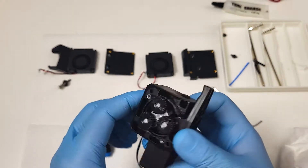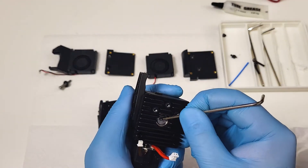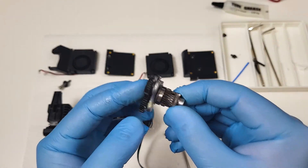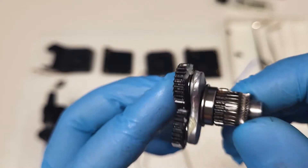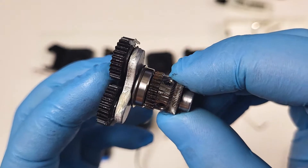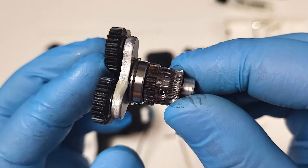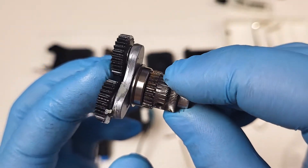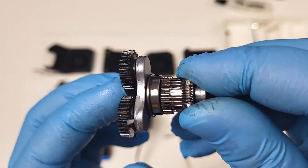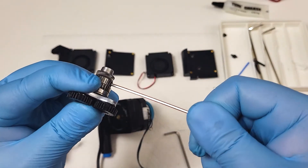There is a very rich amount of grease on the gears. Press the rod within the bearing and remove the planetary gear assembly. Remove the gear set and inspect the gears. Notice that unlike the SV06 and SV06 Plus, there are two set screws on the spur gear, which should work better and prevent set screws coming loose from rotational force and vibration. That's why I think thread lock may not be necessary — just inspect and confirm it's fully tightened, or you can decide to use thread lock. Up to you.